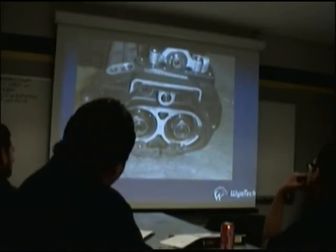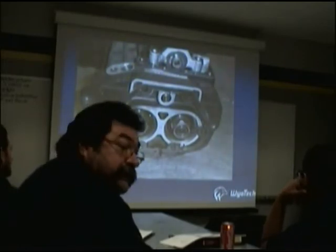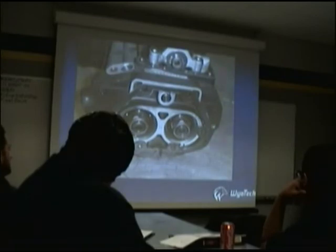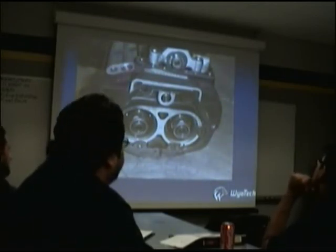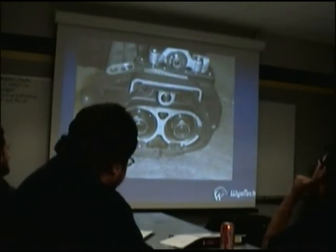On the cover that goes on there - there's a cover that goes over that, and in that cover there's a little shaft with a little fork on it. That's a different style. Is that an old four-speed ratchet top? No, it's a five-speed FLT transmission - one of the oldies. First year of five-speed was an '80. Only FLTs too.